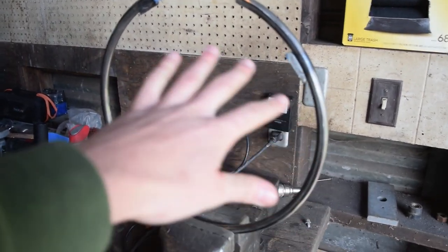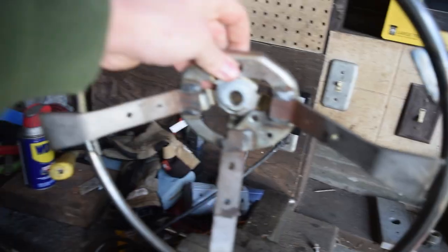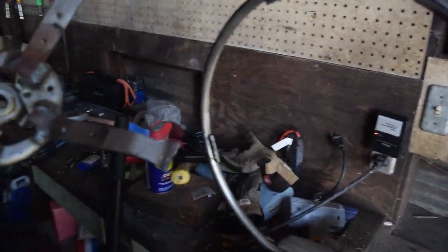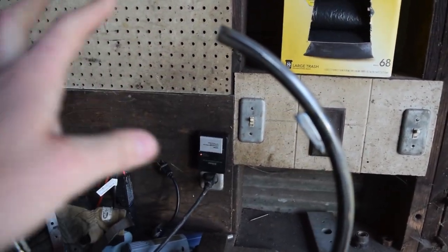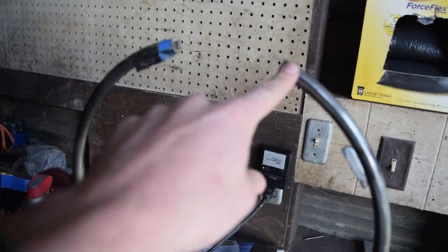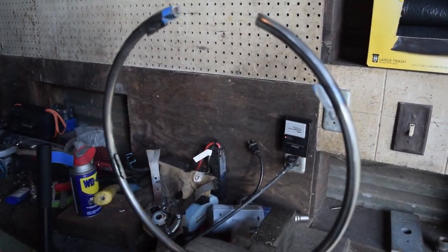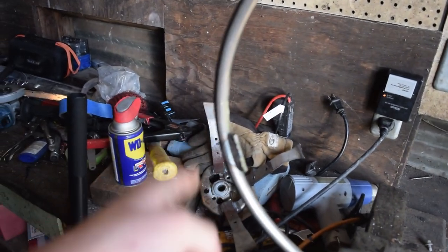So we took out the inside of the steering wheel. The support is now gone. Well, I mean, it's still here technically. Bam, look at that. Looks a lot better outside. But with that gone, we trimmed off a section of the steering wheel so now we could shrink it all up, and this will give us a much tighter radius and diameter for the steering wheel. So this will be connected with this. We're gonna clamp it all tight, weld it up, flatten out the bottom, probably with some fancy tool. I think we have a hammer, and then reconnect that to the center.